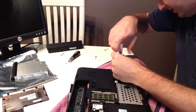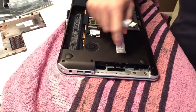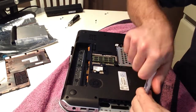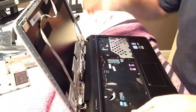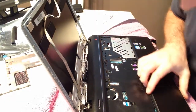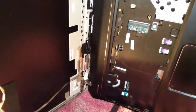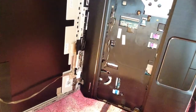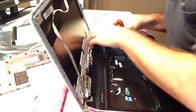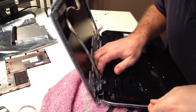So what am I doing now? I am taking out every last screw on the bottom. The disassembly video showed me these two screws here, which are in the ROM drive slot — those have to come out too. Hopefully the top will come off now. It's not coming off like magic. What did I miss? I am basically doing a complete teardown of this laptop to replace the display cable. Of course it's another thing that has to be unsnapped — hear those lovely unsnapping noises. So we have to do more unsnapping destruction. Oh, it's so terrifying every time.